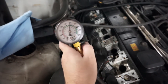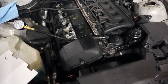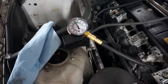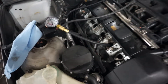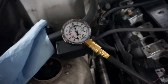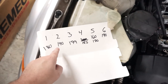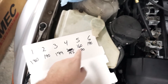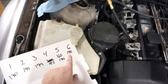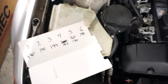We have 180 recorded on number one. Reset the gauge by pressing this button to let the air out, then move it to the next cylinder. I did cylinder two last because of the debris down in that spark plug well. It's about 190 — it drops a little as it sits. Here are our numbers: 180, 190, 179, 185. Number five the first time I tested was 160 but I don't think I got the full five cranks — tested it again and got 170. Number six is 190. This one is crossed out because I forgot to press the pressure release valve before moving it, so that's why it was high. I want to check number five again.